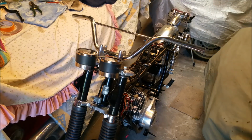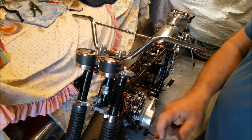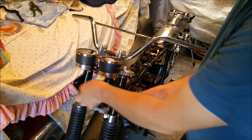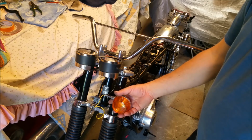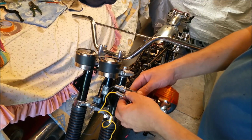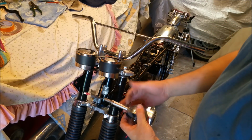The problem I've got, and I've also got these, hang on, before I go any further, and I've got one sitting at the back. These are the aftermarket ones which Neil gave me with the bike, and they've got a steel post and a plastic body. The lenses are slightly different from the OE Suzuki ones, and these ones of course are really, really snugged in to where the light is, because your headlight mounts through here, and that doesn't look too bad, and I'm reasonably happy with that. The only problem is the threaded section there isn't enough to secure the headlight. So with these ones, they're a lot longer in their thread. They're another 8mm maybe. So look, I'm thinking using a nicer housing. This housing's all battered, but using these on the front, or those stalks on a nicer light.